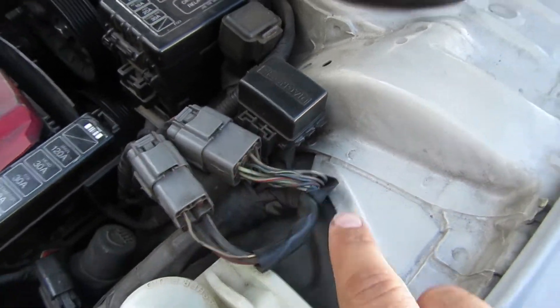I've got a long list of things to try — test coil packs, check vacuum leads, long list posted in the last video. One thing I haven't done is actually check the engine codes to see if there are any broken sensors. It turns out that JDM models don't have a check engine light, so you have to build a little resistor pack with an LED and connect it into the diagnostic box in the engine bay.